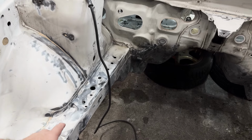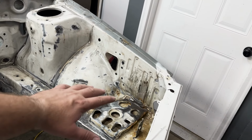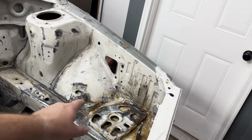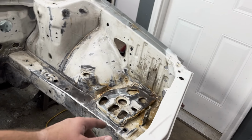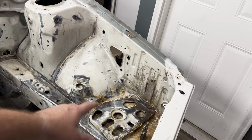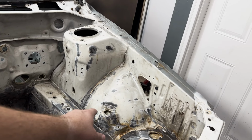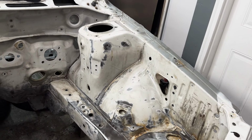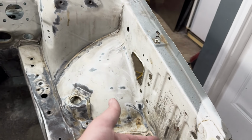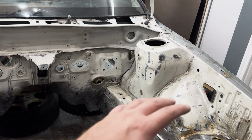I wanna go ahead, just kind of give it a break, see what you guys have to say about that kink there, and then this area here. If you guys have any suggestions about what I could do here, obviously I wanna go through and delete the washer reservoir mount there, the battery tray, and the horn bracket. I think the horn bracket we could put back underneath here of the radiator support. The battery tray, delete that. I think we can put that in the rear, tuck it in the back somewhere to relocate it. And then that mount there for the washer reservoir, I think we can use like a GD1 mounted up here on the back side. And I'll just kind of come up with this hole here. That way you just have this whole area cleaned up and make a little bit more room here in the bay. So I don't know, we'll give it a little thought.